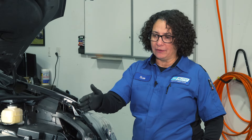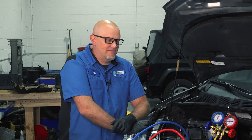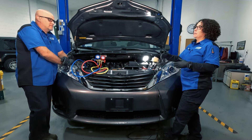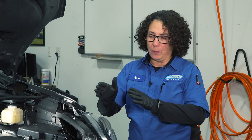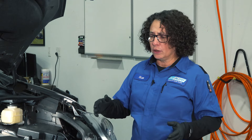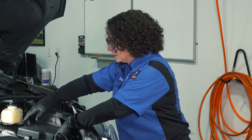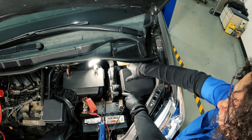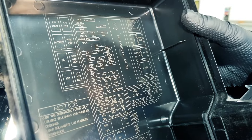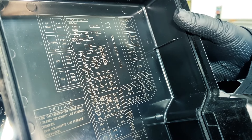So now, like Andy did, he checked the basics — making sure you have power at the compressor. If it did have power down there, it would be easy — we would know the compressor is no good. But at this point, we have no power down there at that connector. So now you need to look up a wiring diagram for your vehicle. You can usually go online and download that. You want to check and confirm going to the power boxes — like the engine power fuse box. There are a couple inside. The diagram is usually under the lid and it tells you the location of the fuse and the relay. So you want to find the AC power fuse and the relay.